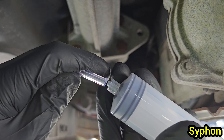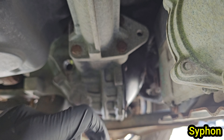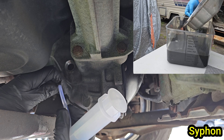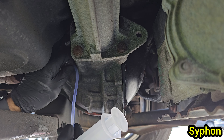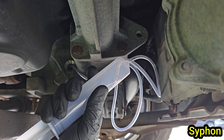The goal is to siphon as much fluid out as possible. There's roughly two quarts in the front diff, so if you want to grab a clear drain pan like this you will be able to see exactly how much you remove. That's pretty convenient and makes it a lot easier to know how much is left.